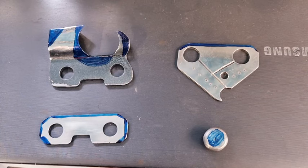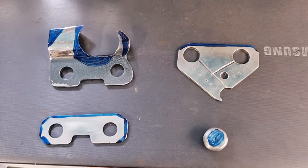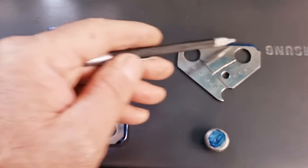After all that, the chain just needs a lot more space to get rid of the chips. They also port and polish the motor, change the timing, put the expansion chamber on. The other thing they do is on the drive link — they can file the bumps down. It just depends on how fussy the person wants to get.